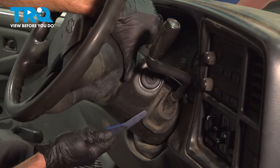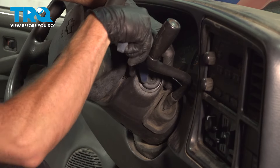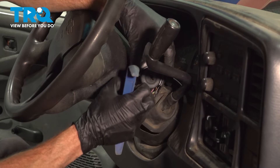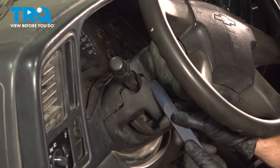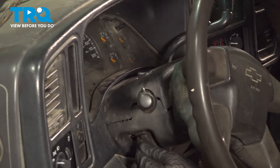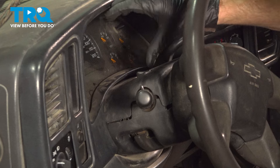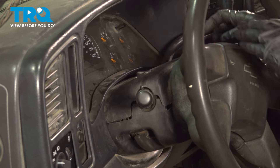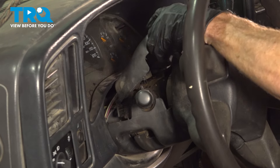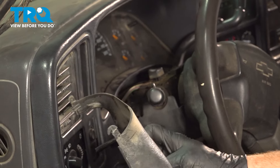You can see where the shifter knob comes through — it does have a rubber protective boot. You don't have to worry about that so much right now; during the installation we will have to get that aligned. There's one side; we'll do the same on the other. Now we should be able to grab hold of this top panel, gently push it forward towards the gauge cluster and lift it up and out diagonally. A quick inspection and we'll set this aside.